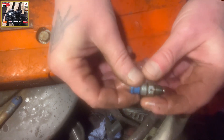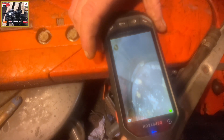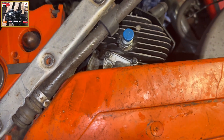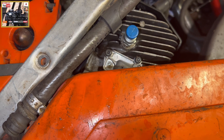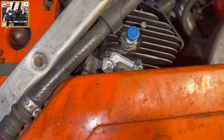You can just see I've got my endoscope in the actual cylinder — you can see the top of the piston there where my index finger is. You can see the little venturi where the decompression valve allows air to pass into the cylinder. There you have it in a nutshell: decompression valves, how to remove them, what to look for if they're failing, and their purpose on a small engine machine. If you like this episode, give us a like, share, and subscribe. Until the next one, take care for now.